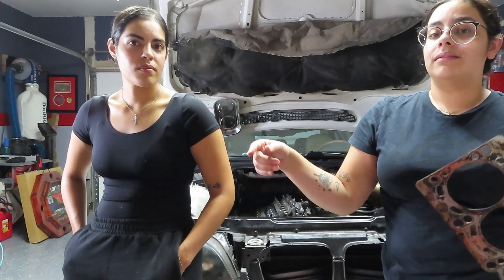It's stripped. So then we took a look back at this and you can actually tell where it burned through the thing because it wasn't held down how it should have been. So now we don't really know what we're going to do. I think we're going to try and find a little kit or something to rethread and put the bolts back in there, so it can actually hold down and this won't happen to the new head gasket that we just put in.